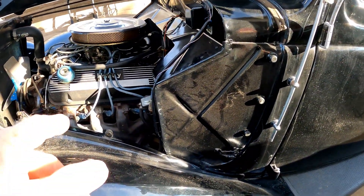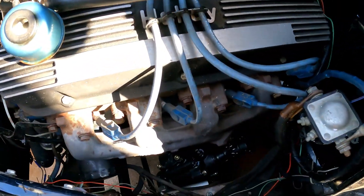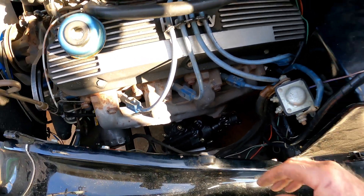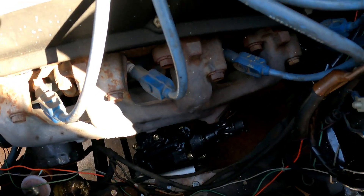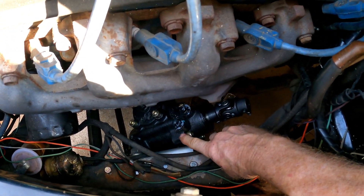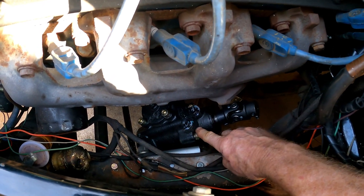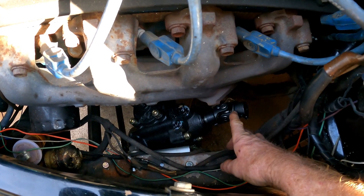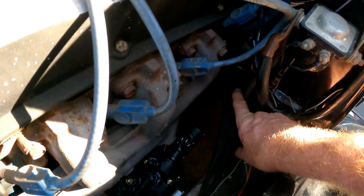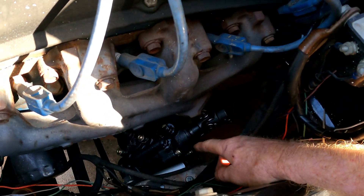What he wanted me to do was put a power steering box in it. Here's the box I swapped in — I can't find the old box but trust me it's about the size of my hand. I originally bought an 800 series GM box that came out of midsize cars, but it was a little too big — it came up too far and was too deep. I had very little room, so I bought a different box.